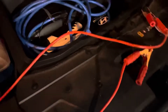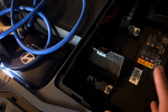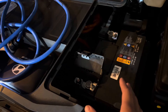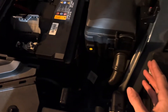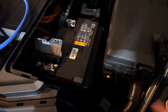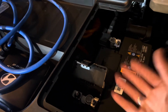Ideally you wouldn't connect the negative cable to the negative terminal because it will spark, which can cause an explosion — this battery can release hydrogen gas if something's wrong with it. I initially tried connecting to the engine block but it also sparked and wasn't successful, so I did end up connecting to the terminal directly.